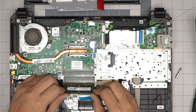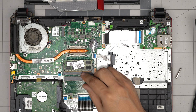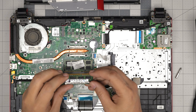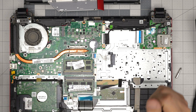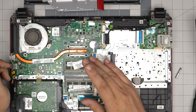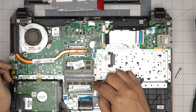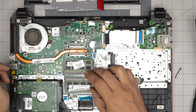You can install it from either side — make sure the notch matches, bring it down at 45 degrees, and push toward the motherboard until you get that nice soft click and the triggers stay closed. I would recommend putting in an 8GB and an 8GB — that way you have dual-channel memory, which is much, much faster than having a single large capacity stick.